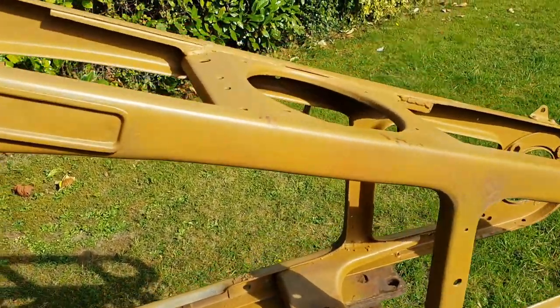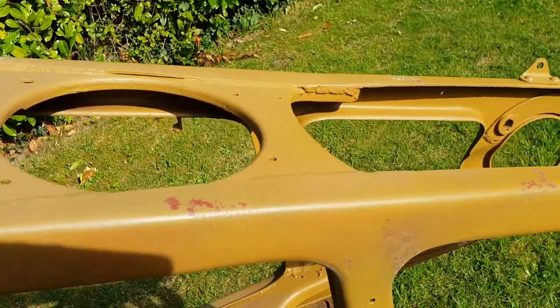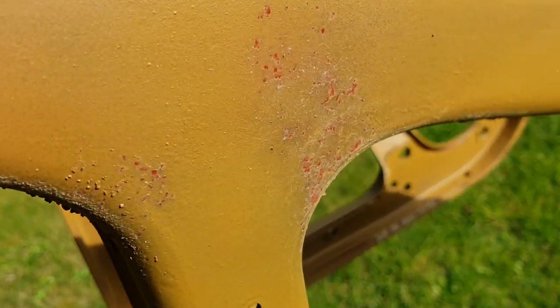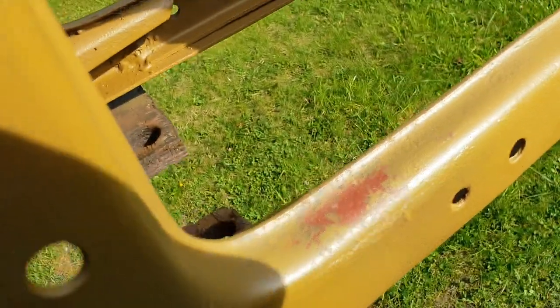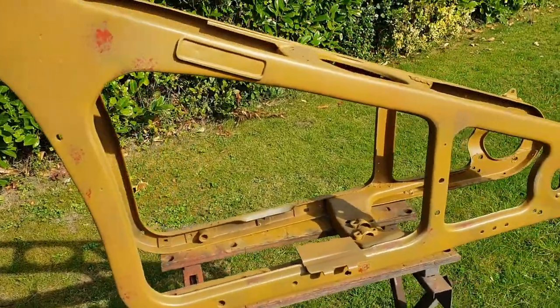The last job at this phase is just to scrape off the salt and sugar — a credit card or something works fine. Give that all a good scrape off, and then we'll be left with these patches which give you that kind of realistic worn paint depth. In here you can see some of the black coloring coming through as well, which I can then work with later when I go around and finish the detailing and aging once the frame is assembled.